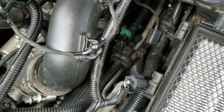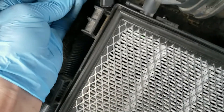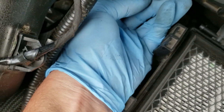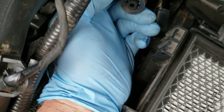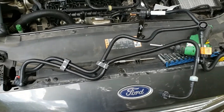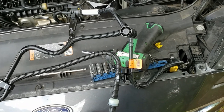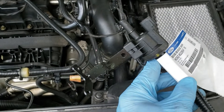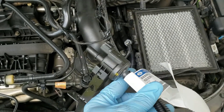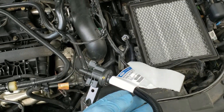I'll show you some of the things you've got to do — the clips to get it freed up out of there. This one you can see had two little detents on the end; I had to push those in at the same time while lifting up with a little screwdriver until it released so I could slide it right off. Here is the new solenoid assembly with the attached hoses. They sell them with the hoses attached instead of just selling you the solenoid piece, but you've got to replace the whole piece in order to get a warranty.